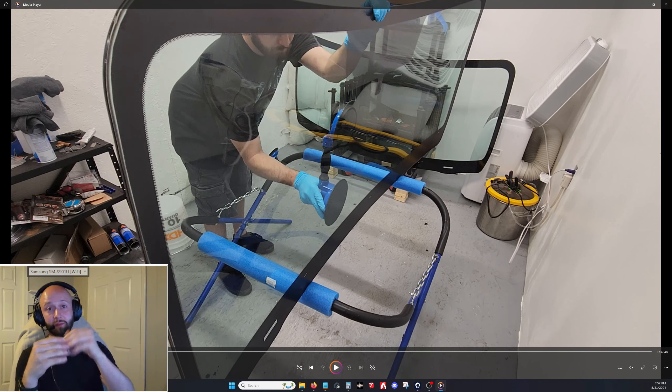Think about the extra couple pounds of urethane on the glass as you lift it, then gently slide it through the poles between the front and back glass without smearing urethane on the back. It's a very gentle process. Do dry runs, make sure you can do it reliably, that nothing is in the way, you're not tripping over anything. Swap gloves any time they get smudged — get a 50 or 100 pack because you'll burn through them.